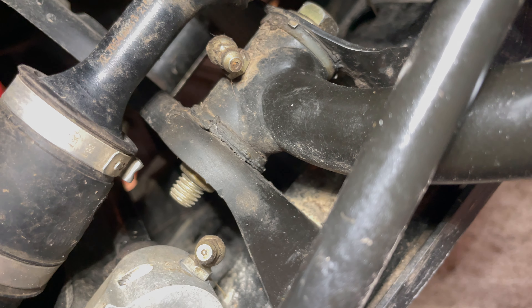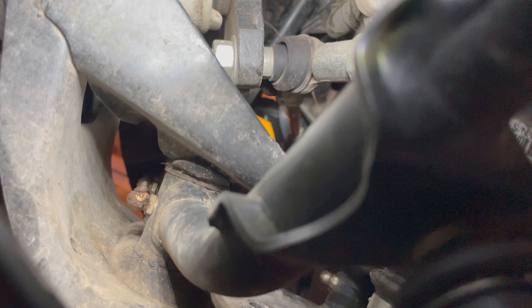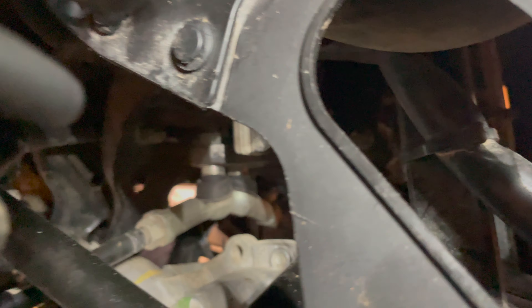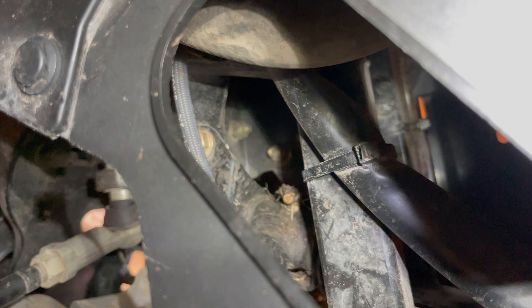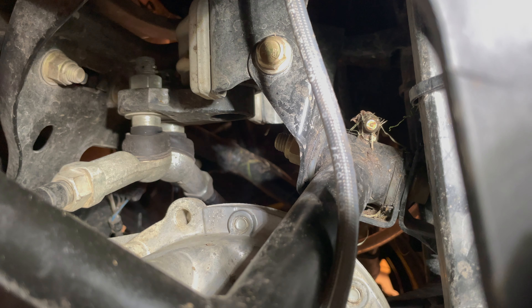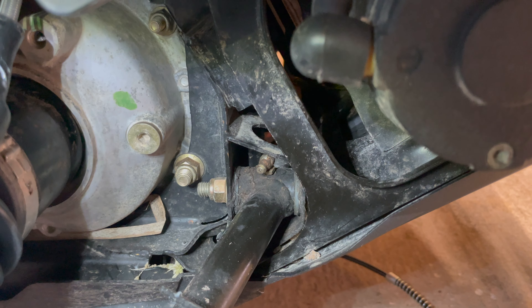We're going to start up here with the lower control arm. You've got one there and one there, and it's the same on the other side — they're symmetrical. Look up here, there's one right there, and you can barely see it but there's one on the other side again because it's symmetrical. Then also in the front, go right in through this plastic here — there she is — or you can come in this way. That's probably your easiest. Mine's obviously dirty so we'll wipe that down before greasing it. There's the other side of the lower control arm.